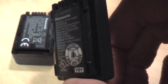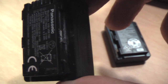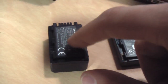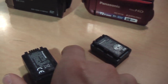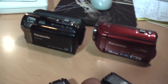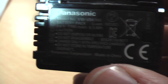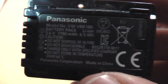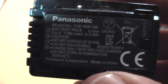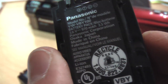The low capacity battery does not have a tab in the middle. This high capacity one had a tab until I broke it off and filed down the edge — and that's the trick to get one of these high capacity batteries to work with the V110. This happens to be a VW VBK 180, rated at 3.6 volts and 1790 milliamp hours, while the one the V110 came with is only 970 milliamp hours.